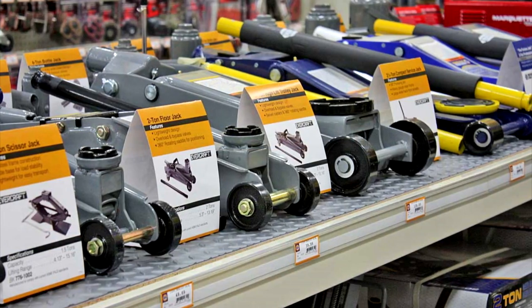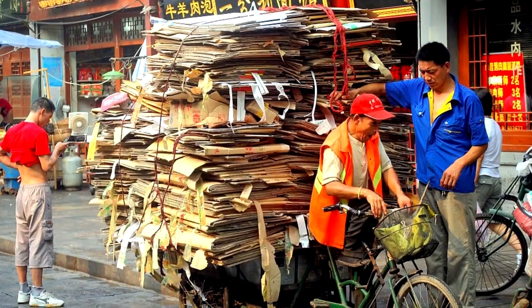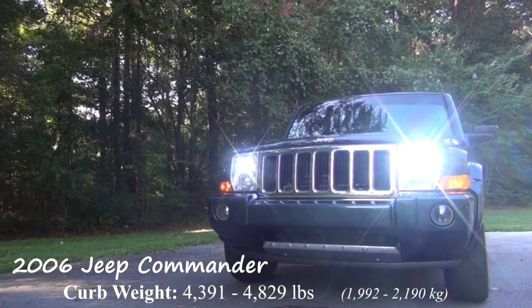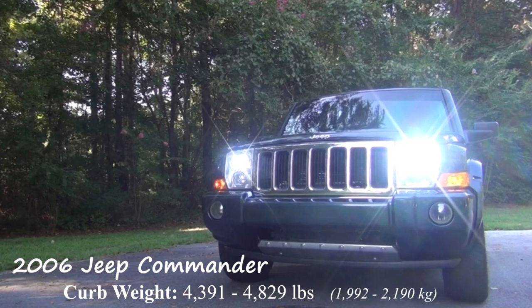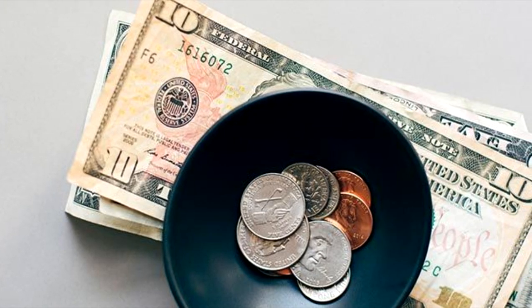I have a personal philosophy when it comes to jacks and floor stands: plan on buying more than you currently need. In other words, try to look for a jack that can handle at least 1,000 pounds more than your overall vehicle's weight. I think it's better to overkill it than risk your life just to save a few dollars.